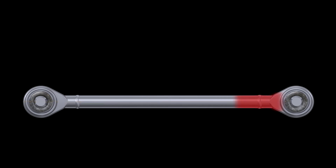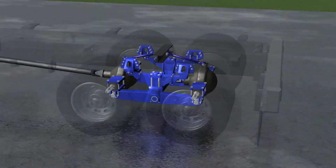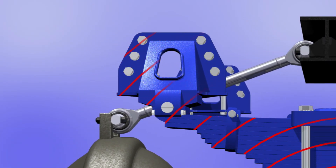Returning to our baseball analogy, this wind-up introduces a force, like the pitcher snapping his wrist, that puts a spin on the path of the energy as it travels throughout the suspension. It propels the force off the centerline path and prevents the suspension from working correctly and carrying the load and stresses the way it was designed to do. As a result, airbags, shocks, bushings, and brackets, fatigued by misaligned stress, can fail prematurely.